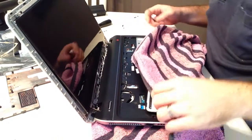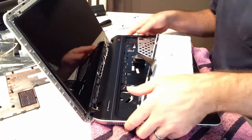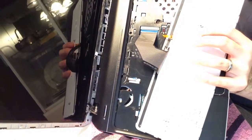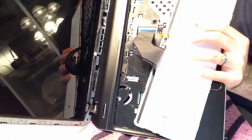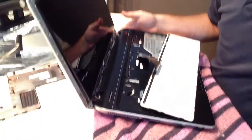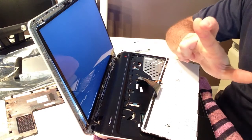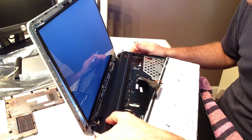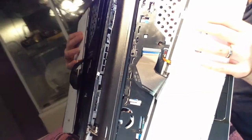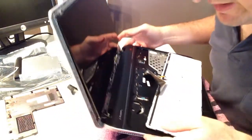I'm gonna reattach the keyboard, connect the display, get that put in, and then do a power-up test just to see if the screen works — see if I have that display connector connected right. At this point it's a total crapshoot; I really couldn't tell if it was on there right. Here's another 40-pin connector, new little sticky thingy that holds it in place — that's pretty cool. Stick that to the bottom of the screen, which seems to really like sticking things to other things. Alright, power button ribbon appears to be connected, keyboard's connected. Here we go — I'm going to put a little battery in and hit the power button. Wow, the screen works! Okay, cool — I guess it's plugged in right. I'm excited; I didn't expect that to work.